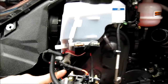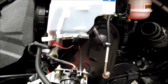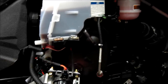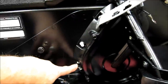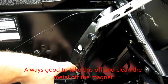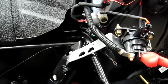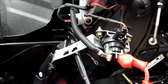The cover's all back on with all bolts torqued to 89 inch pounds. This particular chain case on this sled takes about 250 milliliters of chain case fluid — pop the cover off, fill it through there, and put the cover back on. Don't cut or tear it with a screwdriver. On the 4-stroke 1200s it's 500 milliliters, with the plug higher on the side of the chain case. With so many different models, look up the correct amount — 250 or 500 will cover most models.